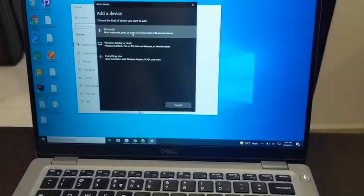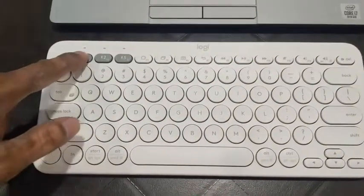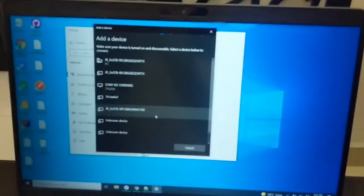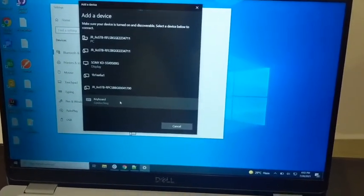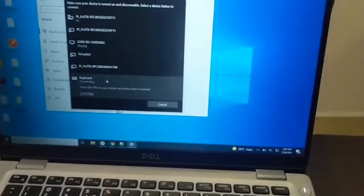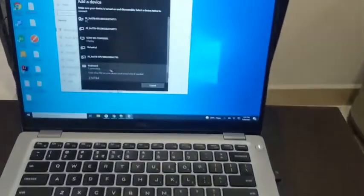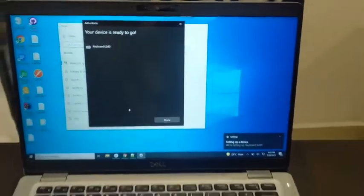On your keyboard, press key '1' to assign it to the first slot for this laptop — the LED starts blinking. Your keyboard will appear in the list of devices being searched. Once it shows up as 'Keyboard,' select it to connect. A pairing code is displayed on screen — I just type that code: 2-7-4-7-8-4, then press Enter. The Logitech K380 is now paired with my laptop.